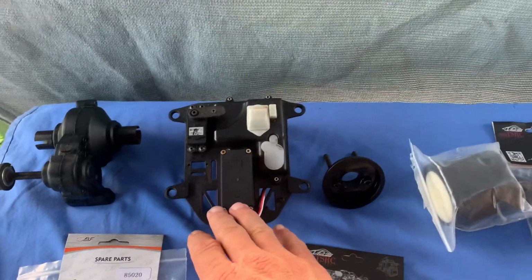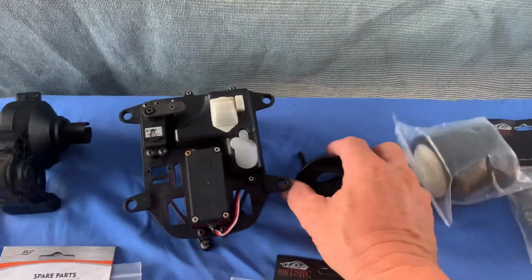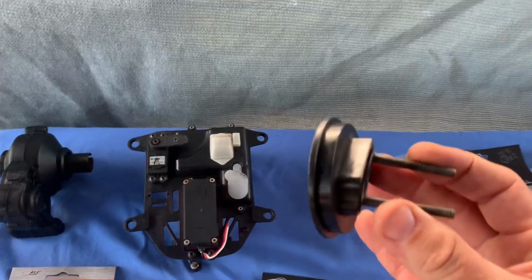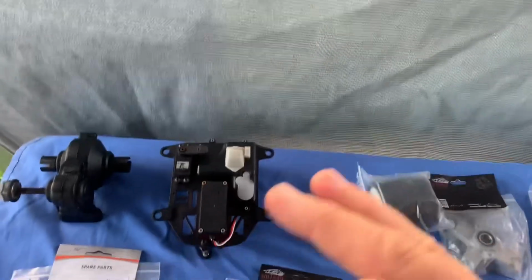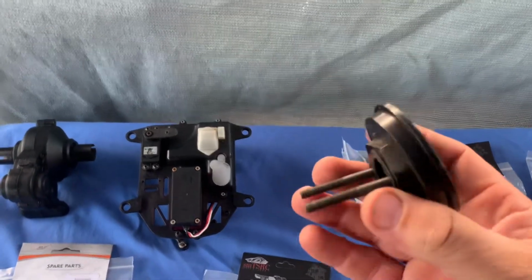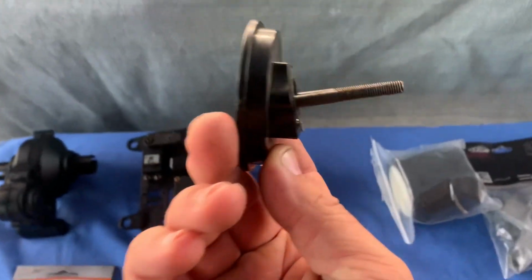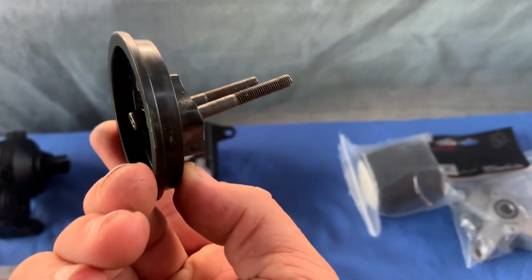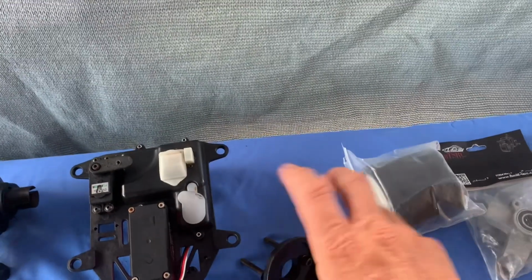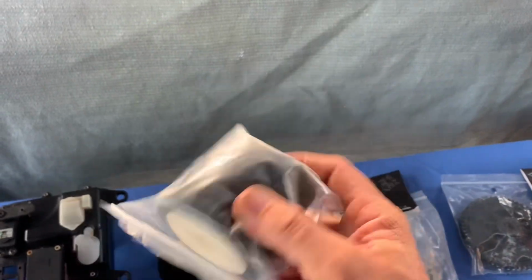Sim steer setup, which will hook up all the stuff that's under there. Will hook up to the front. This here. Now, I'm not going to run a velocity stack. I'm going to run a normal air filter, because this is going to be doing a lot of bashing, so it's going to be dusty. So I'm going to have a two-stage air filter on this. But these here on the front, most of you guys probably would have seen these. The way they're set up causes the air filter to kick up a little bit, so it's off the tank. So I'm going to run that with your normal Baja two-stage air filter.